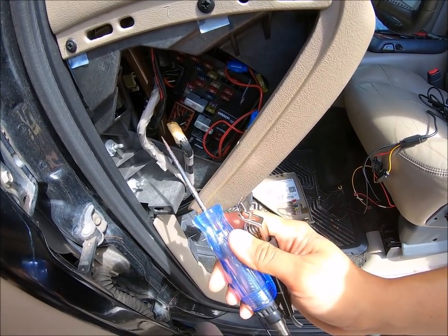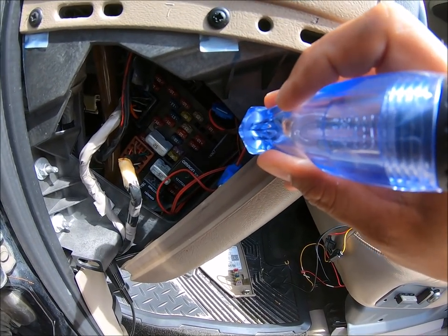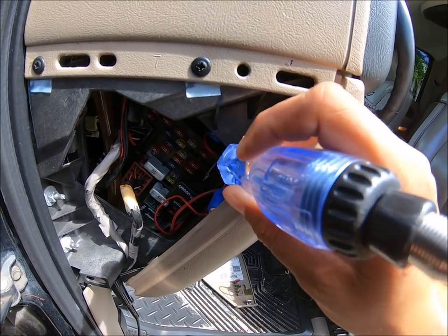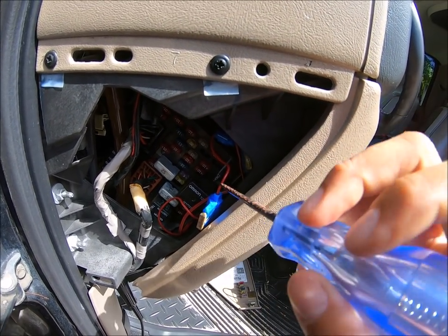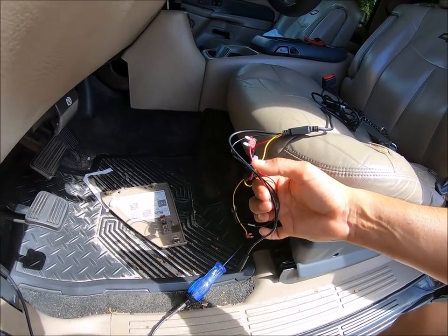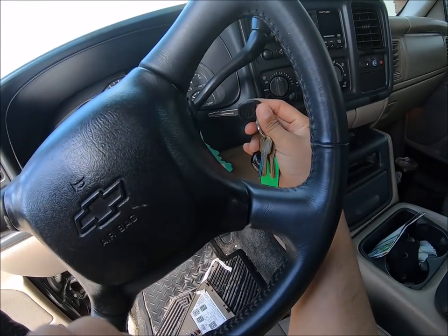Keep in mind, I need one that's always on and one that is on only when the key turns over to position one in the ignition. I've already located the one that has power when the vehicle is off — that is this 10 right up here on top. By touching the little metal diode on the top side, it illuminates, indicating that power is present. Now I need to find one that turns on when the vehicle turns on. I got a lot of number 10s to pick from. If you don't have these 10s, you'll just have to cut it off and use an add-a-fuse at your desired location.